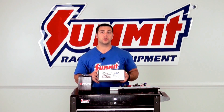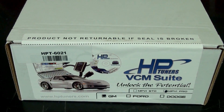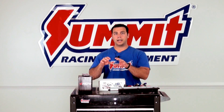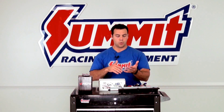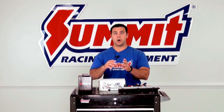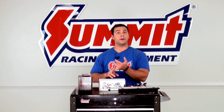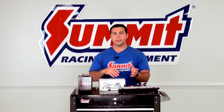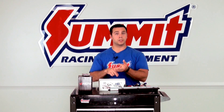To get the most out of those aftermarket parts, you're going to want to step up to an HP Tuning kit. What this software kit includes is some basic software as well as a cable to hook your EFI system's computer up to your laptop. You can create a custom tune — whether it's for turning on more horsepower in the upper RPMs, or you want more torque in the lower RPM range. You can change things like deactivating the anti-theft device, letting the computer know when to shift your transmission, as well as custom tuning for power adders like nitrous, supercharger, or turbocharger.